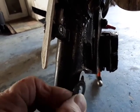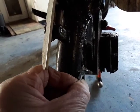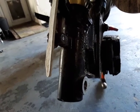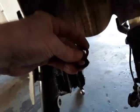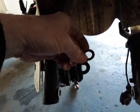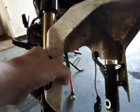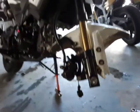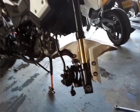What I do is I find washers — some thin, thin washers. You've got to make sure you space it evenly; whatever you do, it's got to be even. So I've got a thin washer on both sides that take up that last little bit of space on either side. That way you know you're not putting any undue stress on the forks and you let them work as freely as they can. It's going to help them wear better too.